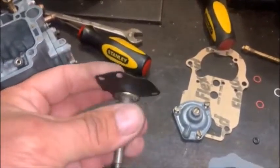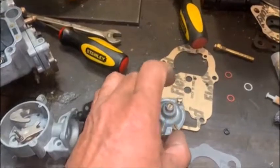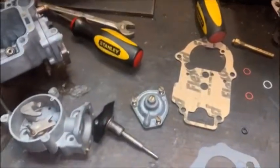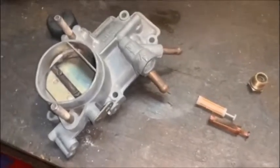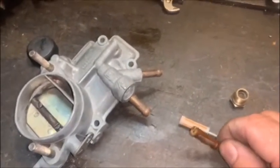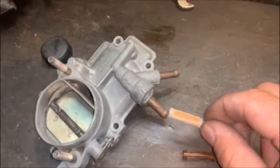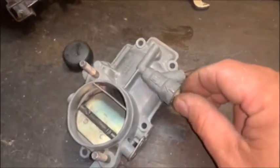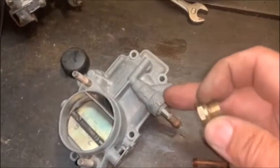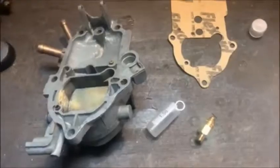It's only the choke, so I'm going to put that together quickly. Again, make sure you've got the right screws because they all look the same but come in different lengths. Next thing is to put the cap and the little filter back. Fortunately you get one in the kit - this one isn't too bad and could have been cleaned up, but I've got a new one. It just goes in there and then the cap goes over. I've cleaned up the cap - there's no gasket for it, it seals on a taper - so just screw that in and that's done.